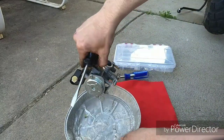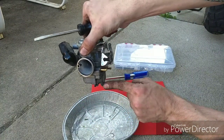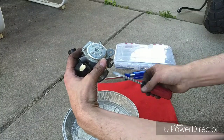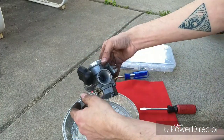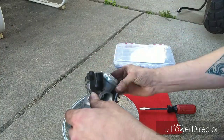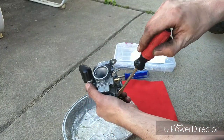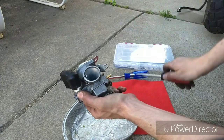Since I dumped the carb over you can see some of the gases come out back here where the gas connects to the float bowl — there's a little screw there. Break that gently, open it up. A lot of the gas will come out; the pan's not too dirty, you can use it to clean the jets. Gas definitely likes to hide in a lot of different places in a carb. Let's not forget to close that back up so we don't forget and have it dump gas when we hook it back up later.